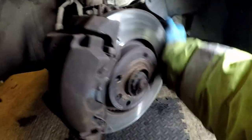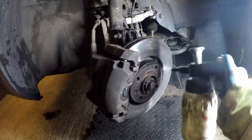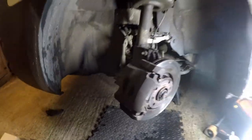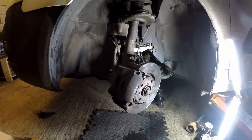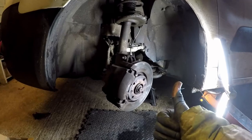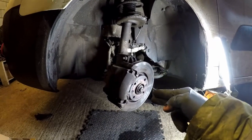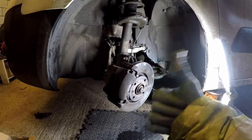The final thing I usually do just before a test drive is use the brake clean to make sure any fingerprints on the disc — whether they're new or old — are cleaned off inside and outside. Make sure you pump up your brakes. Thanks for watching — I hope this has been helpful with changing your brake pads. If you don't feel competent, don't do it. Take it to a pro. This is your brakes, this is your life. Thanks very much.